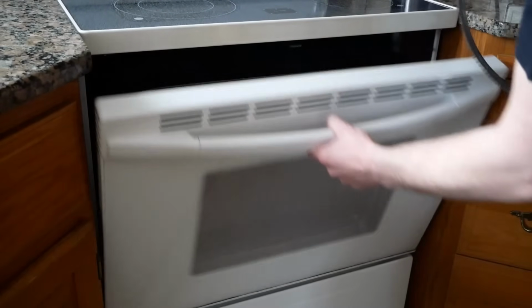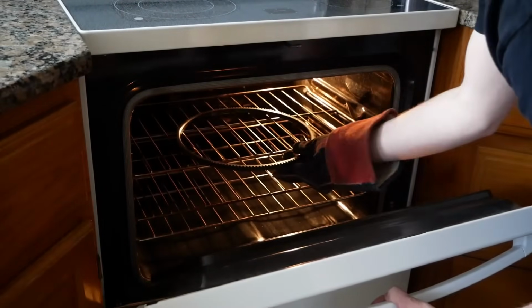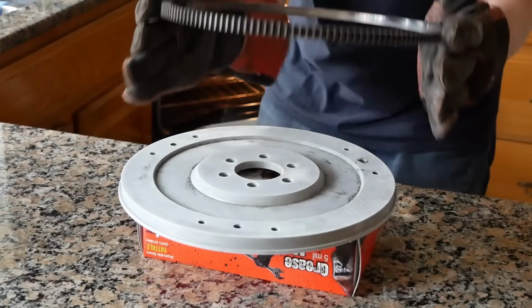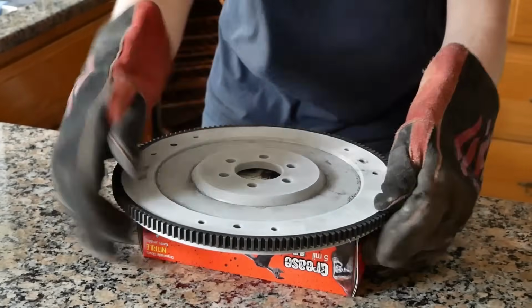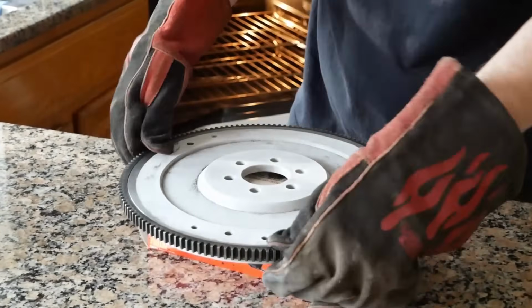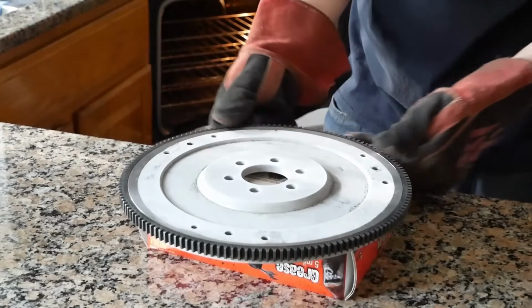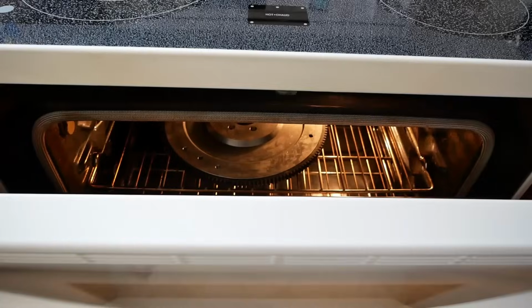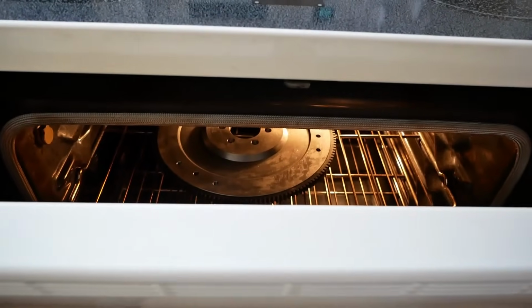To get the ring gear installed, we gave it a clean and popped it in the oven for a bit. We prefer our ring gears baked, not fried. 250 degree oven. That didn't go on far enough. We were able to gently persuade that on with a hammer.